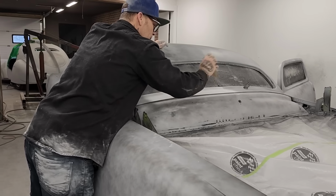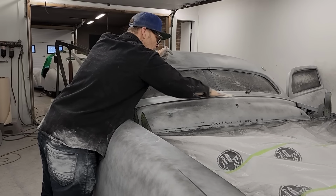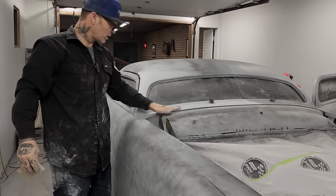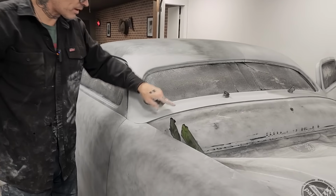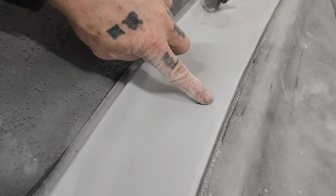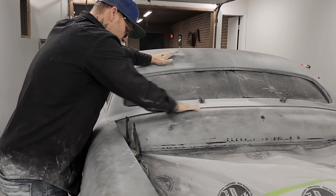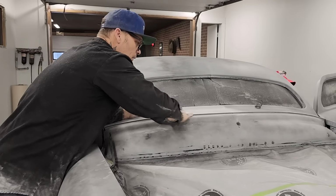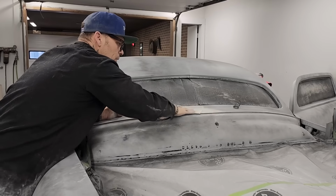Final sanding can make or break you. Sometimes just getting a block in where it shouldn't be, you know. I did see a block in here. You start running the block on this part and get down in that groove and start digging at it. You'll see stuff like that. Come look at this here. You can see I've got that sanded. See them scratches? They got to go. And that's the sort of stuff right there that'll make you happy or not happy. That'll make you not happy. You just keep going. The primer's been on the car for a while, so it should be good and healed.